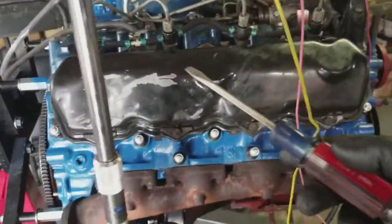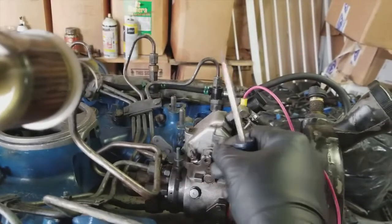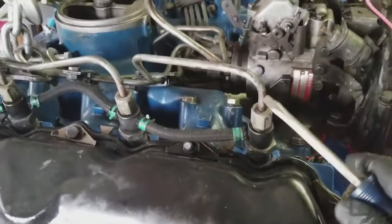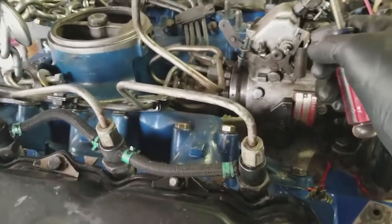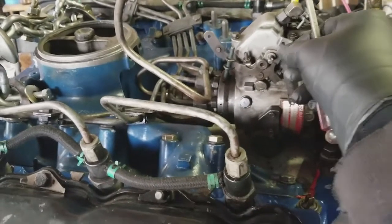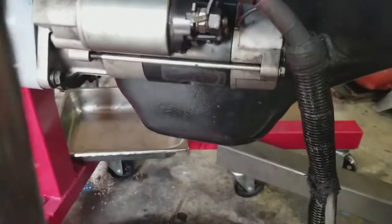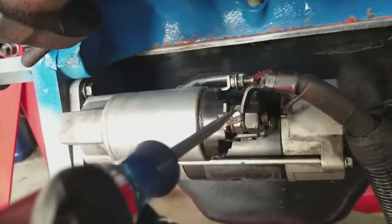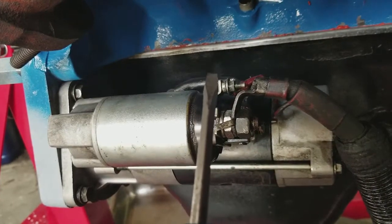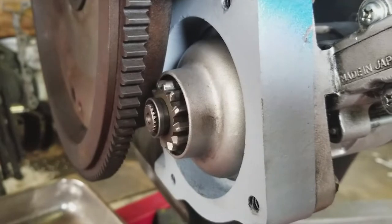You basically just need a screwdriver to start it. You might want to give it a little bit of throttle — about maybe a third of the way. You don't want to go wide open throttle unless you're purging the lines, which I've already done. You've got to purge the air out of the lines, so there's going to be a little bit of cranking first. I took the spring off the throttle so I can adjust it without needing another person. The way you jump this thing is you don't go from the big nut to the big nut — it doesn't do anything. Instead, you go from the little one to the big one in the front, the one that's getting your power supply. You jump those two with a screwdriver or a piece of metal, and it'll activate the solenoid, engage the gear, and turn it.